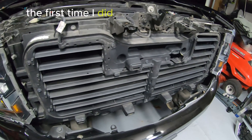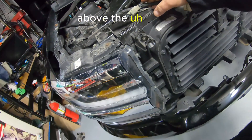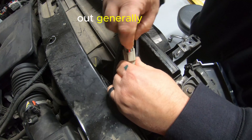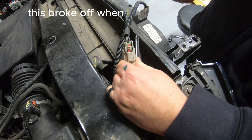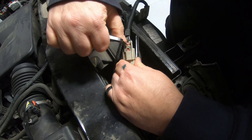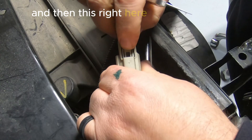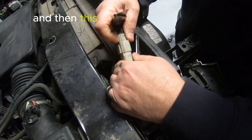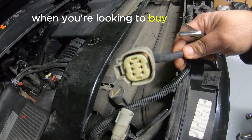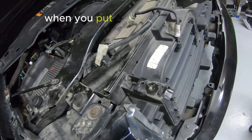This is your plug right here above the passenger side headlight — this usually clips back in there. There's a little red tab; yours will have a little lever on top. Push that down and this will just pull apart — that's the only connection straight to the truck. That's what it looks like when you're shopping for the replacement part. Make sure that connection is good when you put it back on.